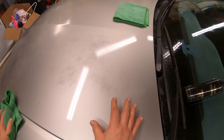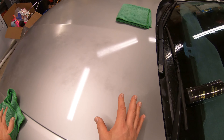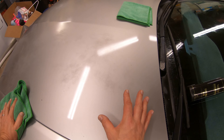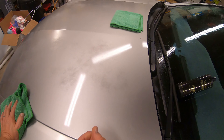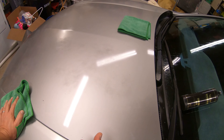There's a lot of guys out there wet sanding paint. All you're doing is taking off way too much clear coat — you're doing more damage in the long run than if you just polish out what you can and then put your sealant on it. As a detailer, I like to do what's best for the car. Ceramics is a great idea as long as you're going to hand wash it and put a booster on it every four to six months. Then that ceramic will pay for itself.